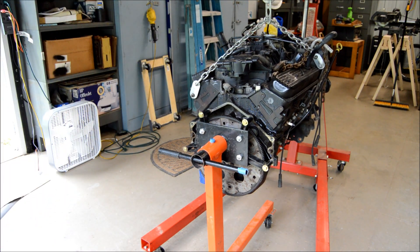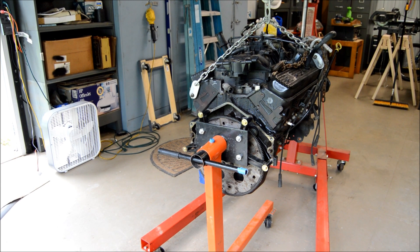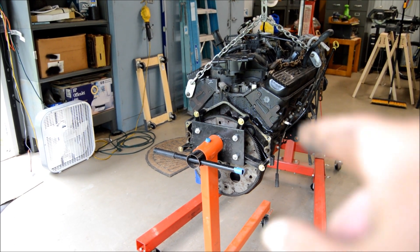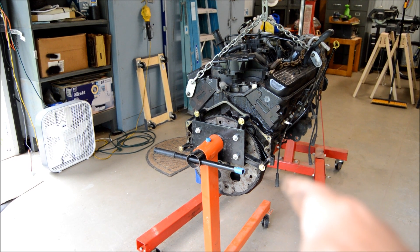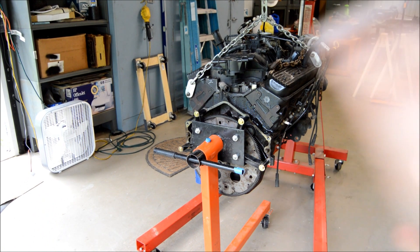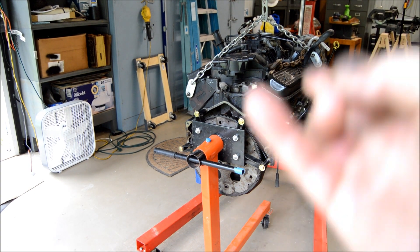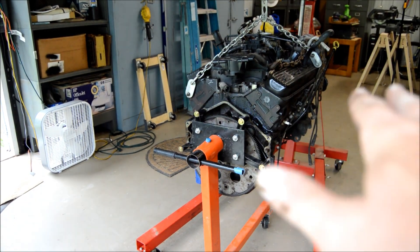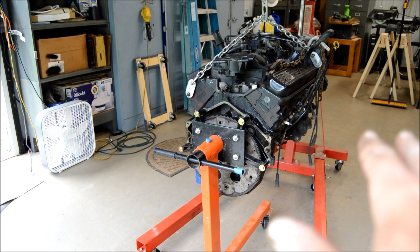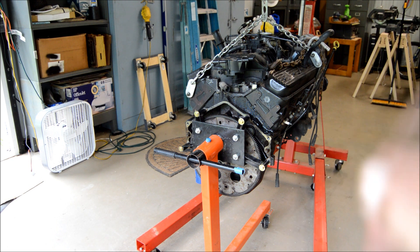Hopefully that helped you out. I just thought I might share this with you because I had to learn this on my own. When you follow the engine stand's recommended procedures, you'll end up putting that thing center with the crankshaft on the engine. The problem with that is if it's a long block, when you go to spinning this thing, it will get really top heavy and you may get really hurt. So be very careful about that. I might even have to raise my plate up just a little bit or lower my engine down in the plate so that I'm totally safe to flip this thing over, because I'm planning on doing an oil pan gasket and some stuff like that while I have this engine here in the shop on the stand.